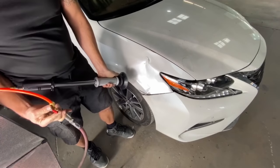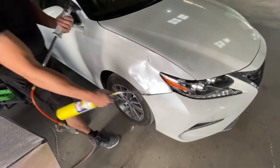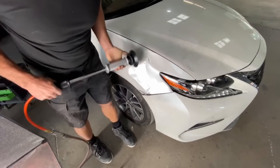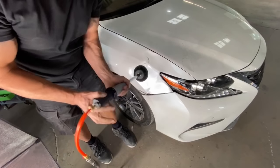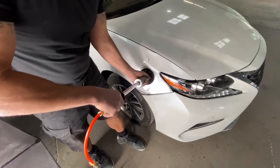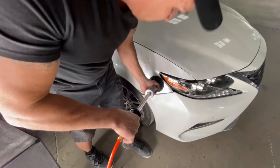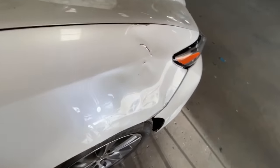This suction slide hammer is quicker than any large round hot glue tabs and it's 10 times stronger than any cold glue. Now getting my flex on with the slide, removing the deepest section of the dent in maybe a minute. This suction cup keeps on grabbing with the continual airflow — these cups never lose their grip. This is a 4 inch cup; I also have a 6 inch cup I use for quick pulls on crushed sideswipe panels at my shop. I have made my money on this $80 tool many times over — probably one of my best investments. The only drawback is you need an air compressor. This is what we have after four pulls with the pneumatic auto body slide hammer.